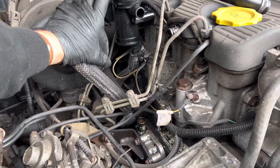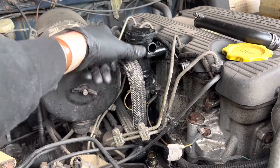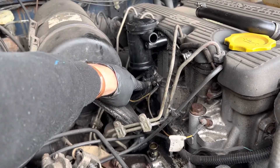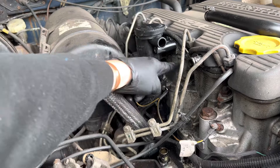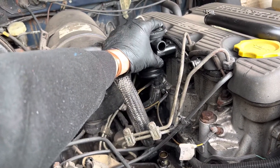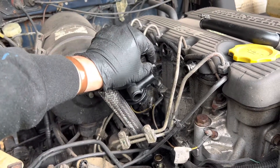The second thing is this plastic part here, which is often called the crankcase breather filter or cyclone — whichever you want to call it. Easy enough to get off: undo the jubilee clip on the top of this hose and pull that off, there's one at the bottom too. Then there's an 8mm bolt that goes through here into the top towards the rocker. Once you've done that, give it a bit of a jiggle and it should come off.